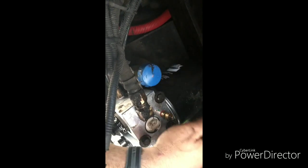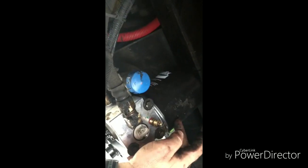Now, if you have a blockage in these, don't just buy the governor or the dryer or just replace the filter. If there's a blockage, there's a problem, and you don't know where the problem is. It could be in the governor, or it could be in your filter, or it could be in this unit here. And let's say you've already changed your filter and that didn't fix it. So whenever you go to replace this, replace the entire unit. Get the kit. See how the governor, this air dryer, and your filter are all in one unit to make sure you get rid of the issue.